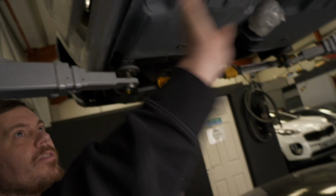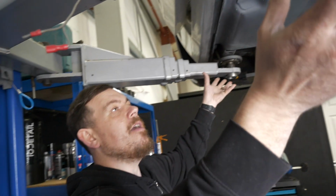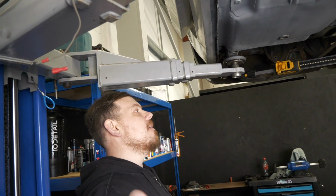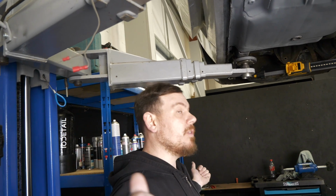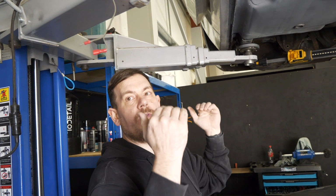Of course, that's the idea here, we're trying to make it as good as possible. We'll be using Gravitex over both sides of the car, stone chip guard over here. We're going to do a layer of it once, then another layer once that's dried, then sand it back so it's not lumpy, but it's still got the depth from the two layers. I want it to look really nice.